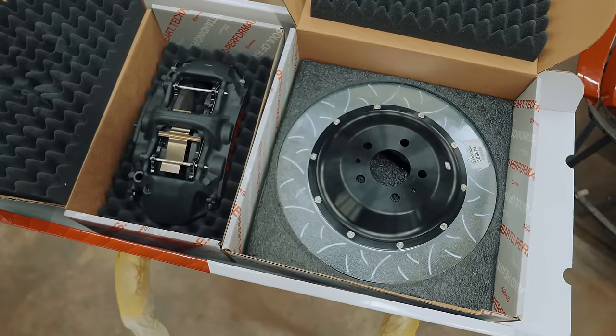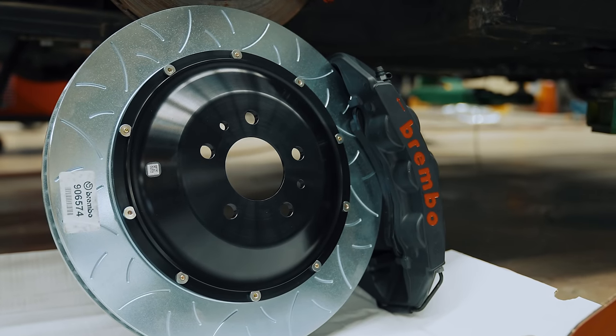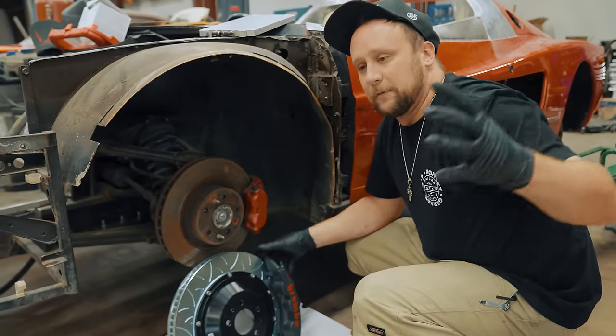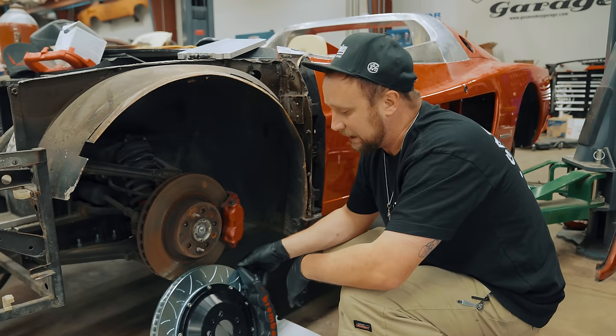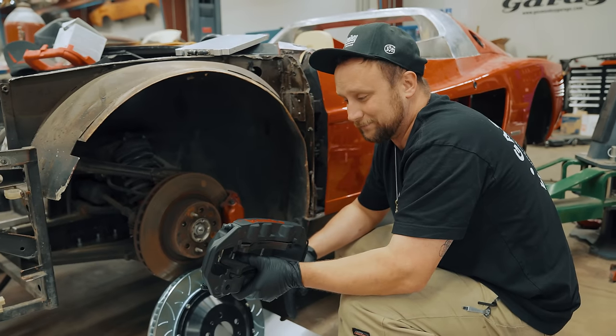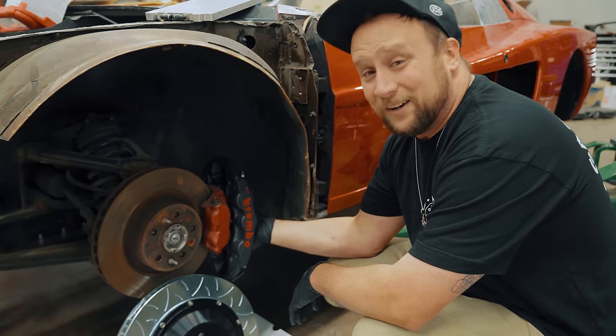On top of our Bilstein coilovers, we are truly going through and upgrading all of our drivetrain components. This EV will be fast, so we obviously need some good stopping power. And there's not a lot of choices for a 1989 Ferrari Testarossa. Our guys over at Brembo hooked us up. I like to tell myself size doesn't matter, but in this case it does. The bigger rotor has obviously got more room to cool, and it's a wider diameter, a bigger circumference, so when these pads grab it doesn't have to strain as much. Think about grabbing a wheel on the very outside and stopping it versus grabbing it on the inside of your spokes — that's how much more pressure it is on the inside. Going to bigger rotors is just a massive help in stopping power and dissipating heat. And then these massive dudes — big six pistons. We're not even hardly going to be able to press the brakes without locking the tires up. Once we do this, put all new bushings in it, our whole drivetrain's upgraded and fresh. I'm really ready to drive this car — it's going to be sweet.